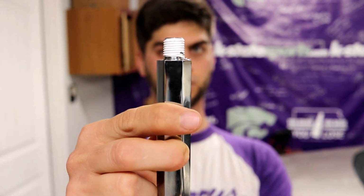But anyway, I was going to spend well more than that on a wrench that, while it would be good to have for the rest of the time, I just thought, you know what, this solves two problems. Since I lost that bit of nylon tubing, I'll gain a little length back, and this ends up being 3/4 inch, so the amount that it sticks out, I've got plenty of room to get my 3/4 inch ratcheting wrench on it and get that tightened up, which I'm going to go do right now. I already got the Teflon tape on the threads, so I'm going to get that in, and hopefully we can get this buttoned up, if not tonight, early tomorrow.